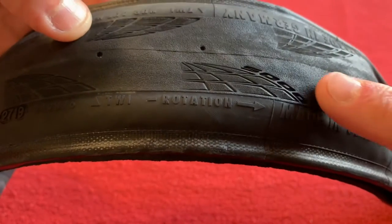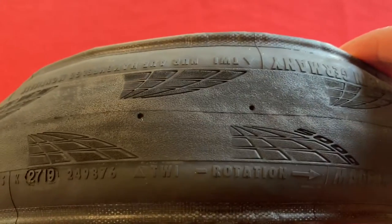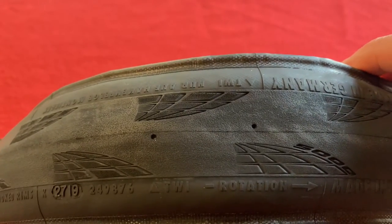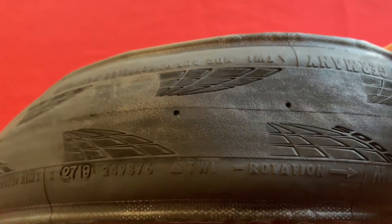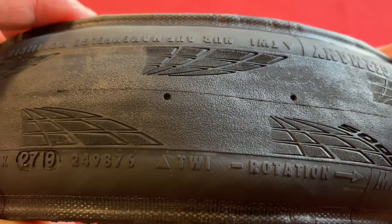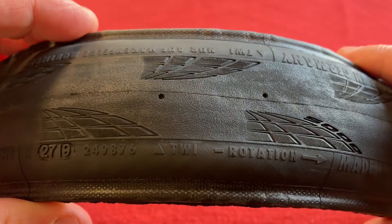I've found the 5000 label just after the grip. And if you're wondering what these two dots are, this is a tread wear indicator. When you've got dots, the tread is fine. When the dots are worn through so you can't see them anymore, it's time to change your tire. Just a little thing that Continental tires have got, which is always good to look at.